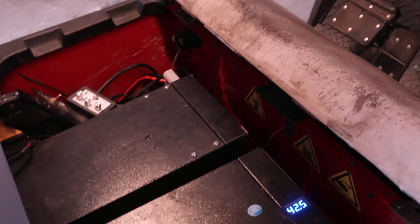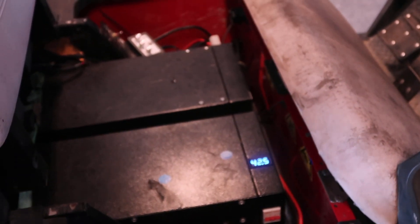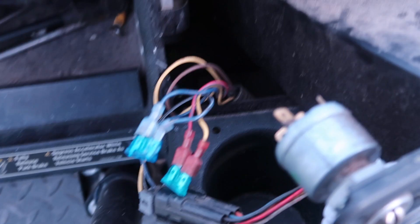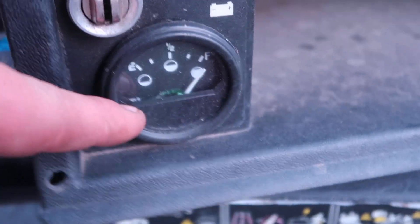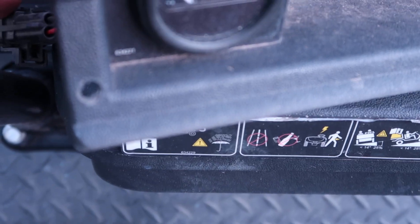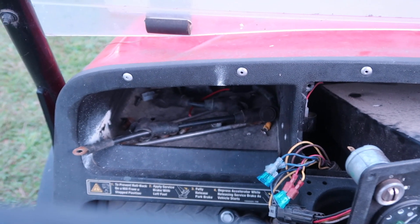Alright, so I charged up last night — I'm getting 42 and a half volts on this one, and around 42 and a half on that one as well using that stock charger. So it's put down about 85 volts with these two batteries. It is 72 volts nominal but 85 volts once it's charged up. I still think I can get a little bit more and might have to go with the factory charger for those batteries. This right here is for the lights that don't work. This is my ignition switch currently because I still don't have a key. However, when we put the ignition switch in, the voltage indicator light on the dash works — so once we unhook this and switch it, the cart goes off; put it on and it cuts back on. Still have a ton more bolts to put back in the dash and it's not fully put back together, but this is a fun little golf cart.